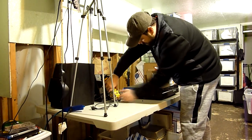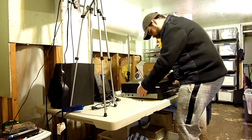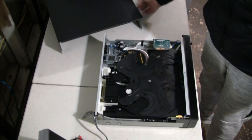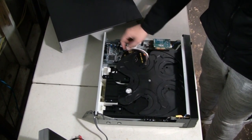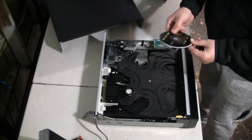I didn't see any problems at first — I was opening and closing the tray fine. Then I decided to unplug it, unscrew the top cover, and see what it looked like inside. Sure enough, there were actually two CDs stuck underneath the tray, in a position where you could see it was causing a lot of ruckus in there and likely causing the tray to malfunction at times.